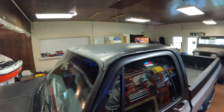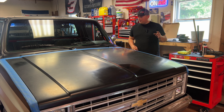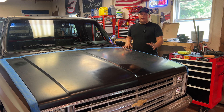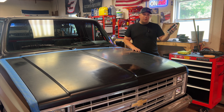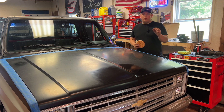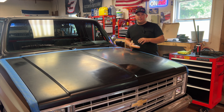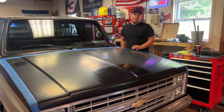There are some scratches but we don't have time for that — we got a whole list to take care of. We can't exactly do a traditional compound and polish job here because there's no clear coat on this paint; it's just spray bomb black. What we're going to use is a cutting polish — it's like a hybrid one-step — with a medium cutting pad. We're actually going to be removing a little bit of paint to get it shiny again, so this will end up turning black. I got the edges taped off so that if I polish onto the fender a little bit there won't be a shiny spot right there.